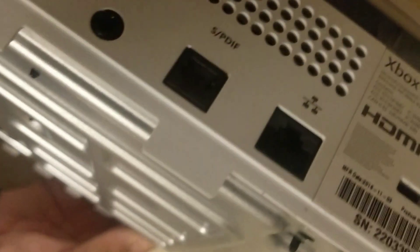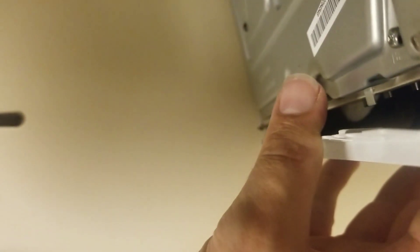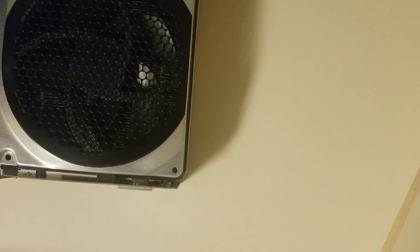Start with the back — there's always stuff in the front that you don't want to damage. Basically just yank the system from the back. Once you've got it turned down, dig your fingers in and pull the front plate while you pull the system diagonally away from the front. That way you're not going to break off any of the boards or mess up anything to do with the drive. Also watch the Wi-Fi/Bluetooth card over here — something else you don't want to mess up.